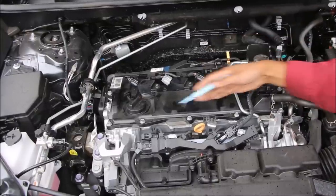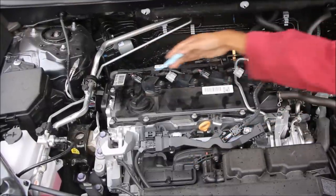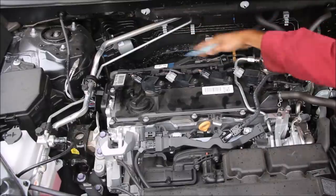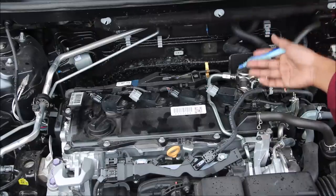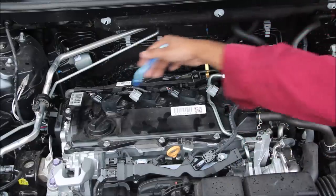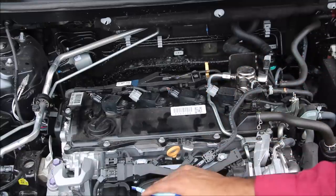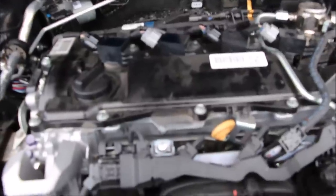This is a double overhead cam engine with the intake camshaft on this side and the air intake over here, and the exhaust camshaft on the far side with the exhaust manifold going down to the back. Now this engine is actually both direct and port injected. We have the high pressure fuel pump over here that's driven off of the exhaust camshaft and sends high pressure fuel down this hard line to the injectors in the engine head. That loud ticking sound is actually from the direct injectors on warm-up.